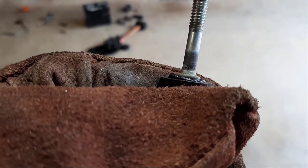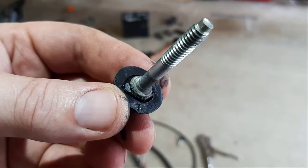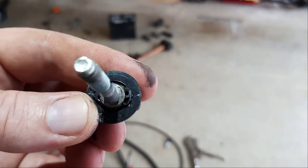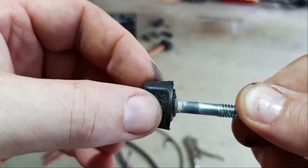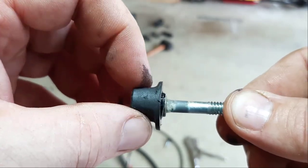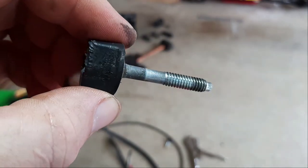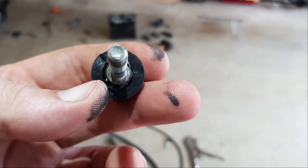Take a box knife and trim the piled plastic off so that the shoulder of the bolt is what makes first contact with the top of the air filter cover. There's the finished product trimmed — you can see that when the plastic melts it encases the bottom of the washer, so it is now permanently on the head of that bolt. The way the washer is inside the plastic, it really doesn't have the opportunity to ever fail again. It's a quick repair, provided you've got the adequate tools, so you don't have to wait on a shipment to get the lawnmower put back together.